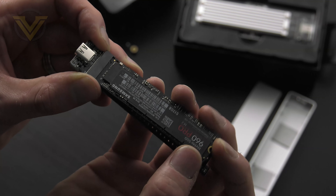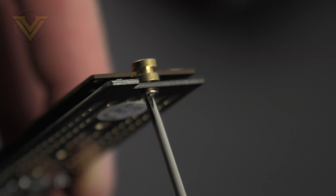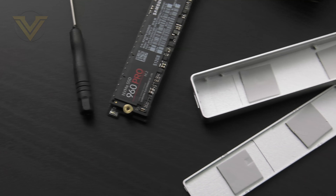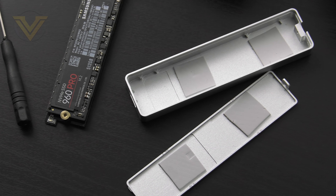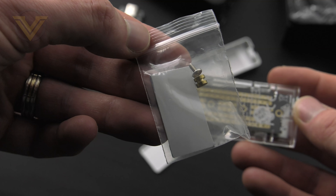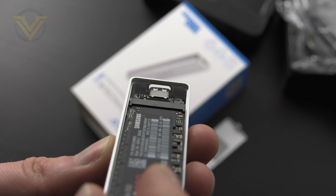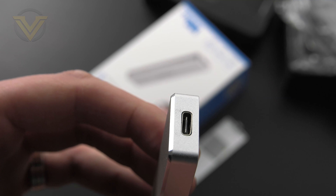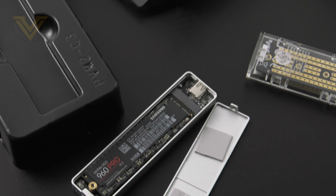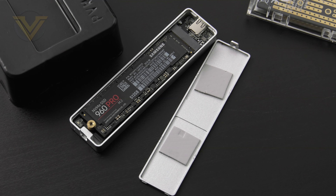To get up and running, open up the enclosure and remove the PCB. Next, take your M.2 SSD and connect it up with the slot on the PCB while also attaching the brass standoff — it has an indentation that slides into the end of the M.2. Line it up with the screw hole according to the size of the drive and attach a screw from the underside, which securely fixes the drive to the PCB. Drop both items back into the enclosure — you can see thermal pads on either side. In the transparent model, thermal pads are supplied in a little bag for you to attach yourself. Line the USB-C port to the cutout, pop the cover back on, and you're ready to go. Just remember: to get the full potential of this M.2 drive, make sure you're connecting to a USB 3.1 Gen 2 port rather than just Gen 1.